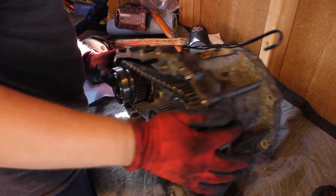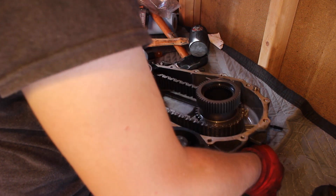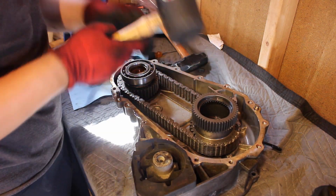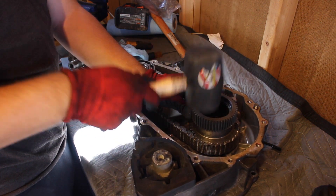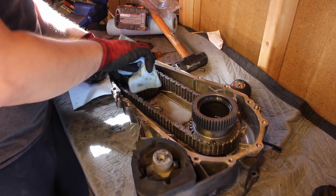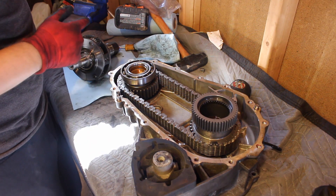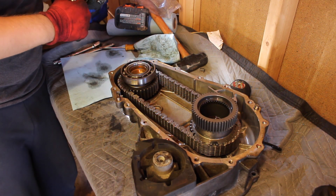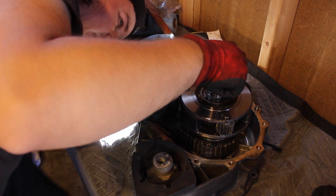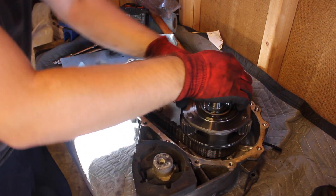The chain is going to make a little more of a clack because it's still new and hasn't been broken in. The seals here were still fine so we're going to reuse the seals — also I didn't buy new ones. Just make sure everything's pressed in adequately. Chain's back on, so now we're going to put our input shaft back on, making sure to keep both spacers where they should be. Just make sure these planetary gears align — and boom, back in business.